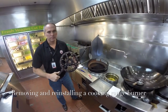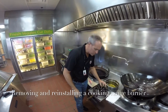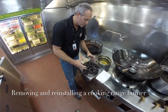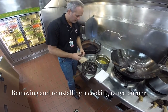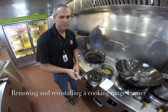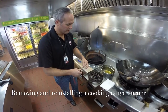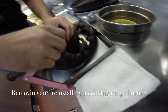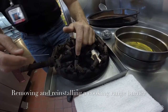This is your cooking burner. A common problem with these burners is the tips. Many times the tips will work their way loose and gas will leak from around the base of the tip, creating a flame, and you won't have a strong flame from your burner. You can purchase a flame burner file from Edward Don. These files are designed to insert into the center of the tip, and you can file out any carbon buildup from the flame so that you have good gas flow inside the tip.